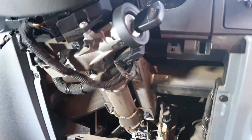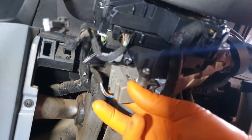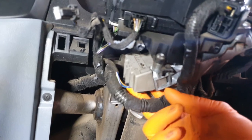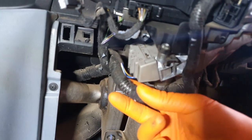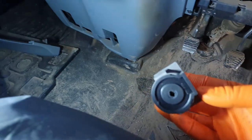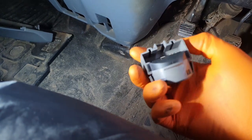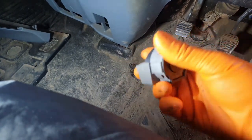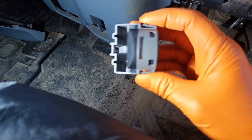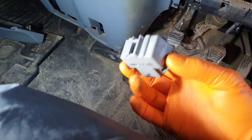So the fault isn't actually the ignition itself — it's actually the electronic contact on the back by here. All you need to do is push in this tab; there are two tabs either side. Push them in with a little screwdriver and you can unslot it out. This is what the new one looks like — I'll tag it in the description so you can have a look at it and I'll show you where to get it from. Basically, it's just a switch that turns on the power, and that's what goes faulty and needs to be replaced.